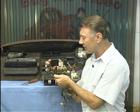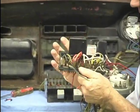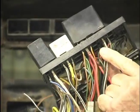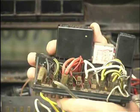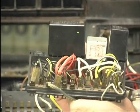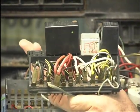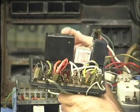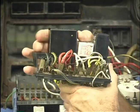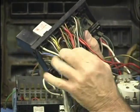One thing to show you: on 1974 models, you may have this special buzzer and relay combination with about 14 connections across the bottom. In this particular year, you had to be sitting in your seat with your seatbelt buckled, the car in neutral, and brake off, or the car would not start. When this thing went bad, your car wouldn't start, and same if any of the switches in your seats went bad. Most of these have been done away with, but yours might still be on the car — you're probably going to want to take it off. The other wires besides the two starter wires don't really have anything to do with running the car.